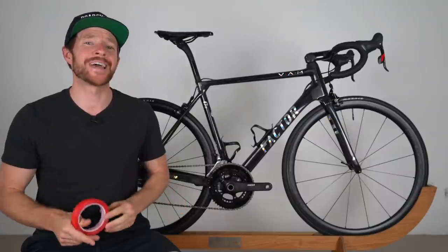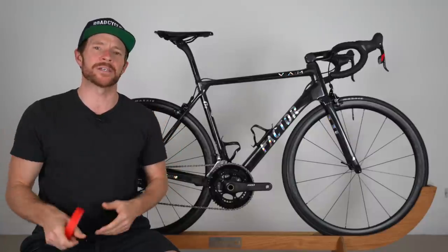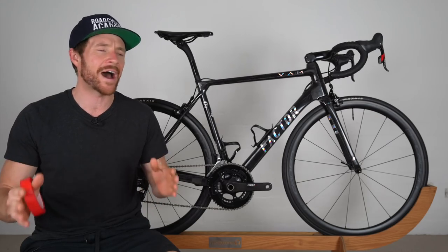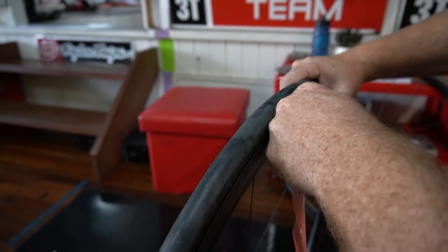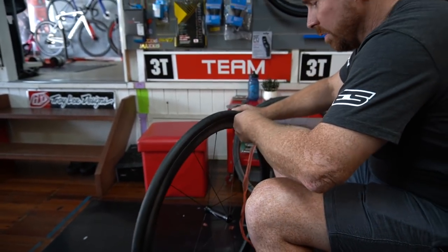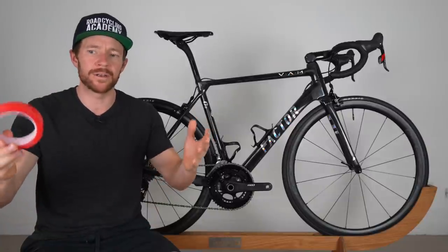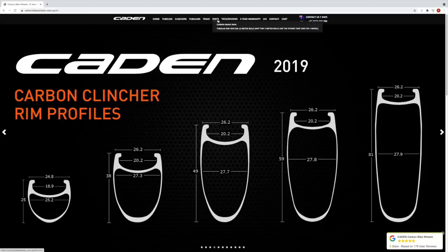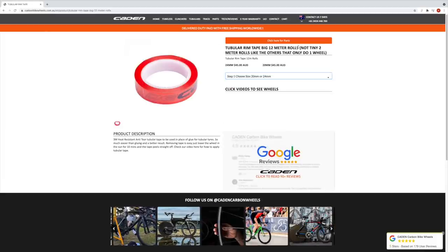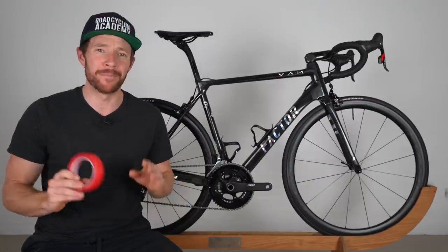While there are definitely some skeptics out there in terms of taping versus gluing on tires, I'm keen to assess things for myself, which I'll share in future content. You'll see today just how easy Jay Taylor runs us through the process using this 3M tape — not sponsored, just telling you what it is — which came with the Caden wheels. This tape comes in sizes 20 and 24 millimeter in width and rolls are 12 meters in length, giving you plenty of rim tape for multiple changes.